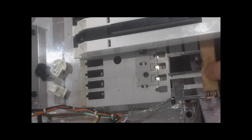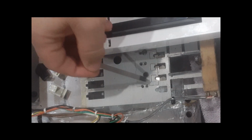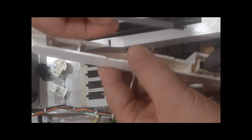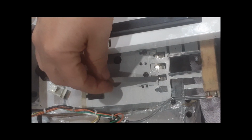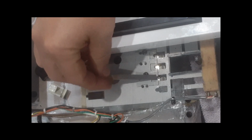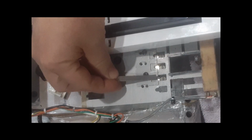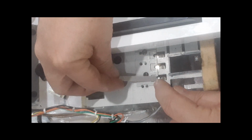So that's the aftertouch, and those are the switches. These switches are very, very delicate. Okay? Now, the problem with this is, of course, the black would be down when we're doing this, because it would be up on the key, right? So when we put it down, the black end of the spring fits right into this little slot, and it's kind of sloppy. I never really liked that, and it could slip.